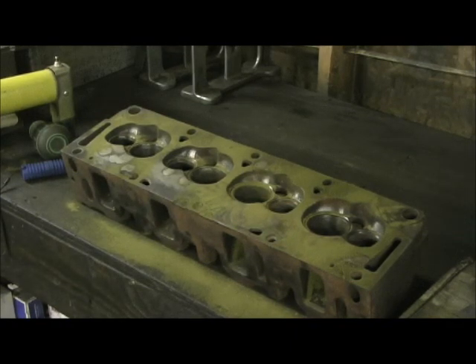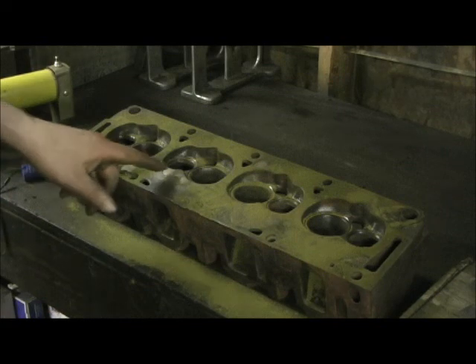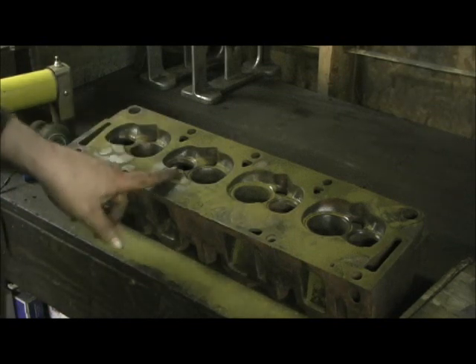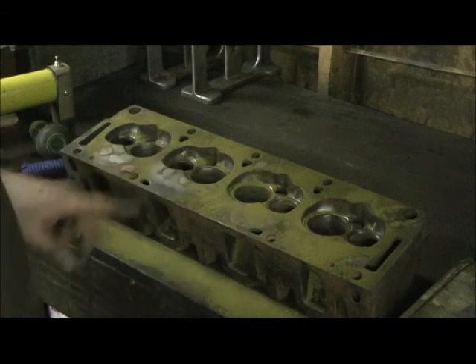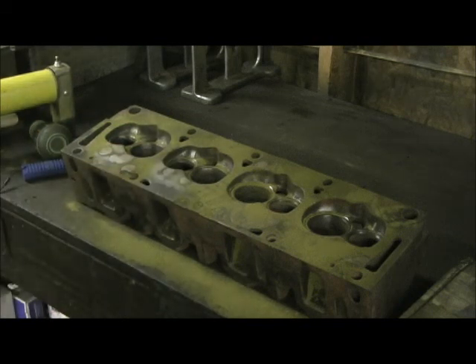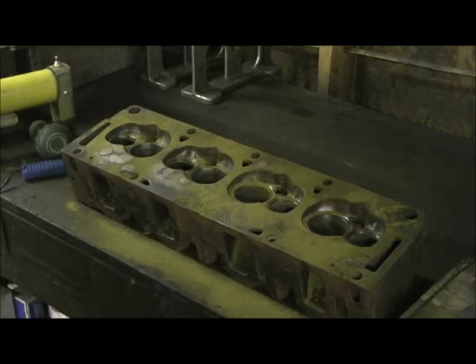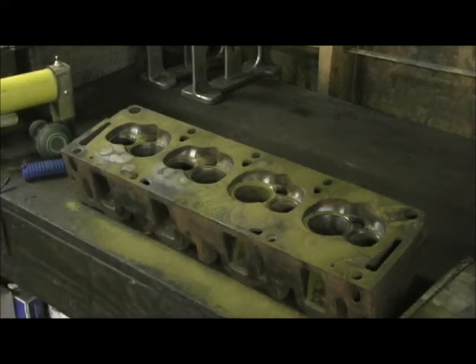What that will also tell you — you'll be able to see how well the nickel blended with the iron in the head, because all you'll see is a slight color variation. The nickel is usually just a touch brighter, but you should see no edges or anything around the corners or the sides. So until I get it back from surfacing, this will be it.